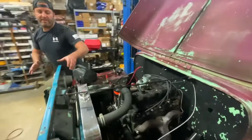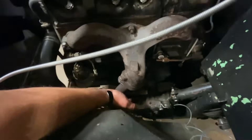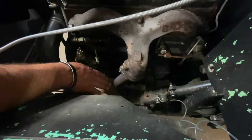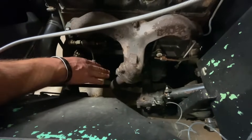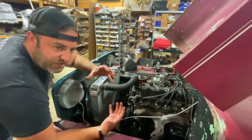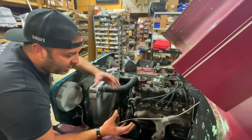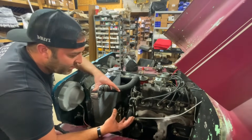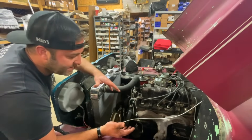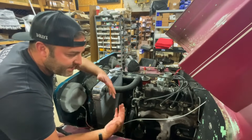What we had to do next was address the oil pump. We only had to remove three bolts — we didn't have to take the exhaust loose or anything. Just remove those three bolts, and it's great if you've got two people. You just pull the oil pump down a little bit — don't pull it out all the way, just lower it a couple inches. At that point, the gear on the end of the oil pump is no longer connected to the cam gear, so it'll spin freely.